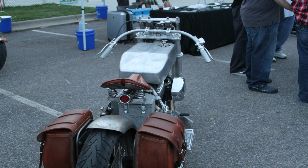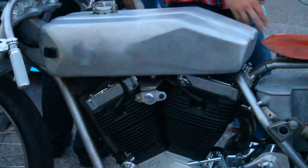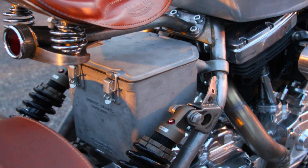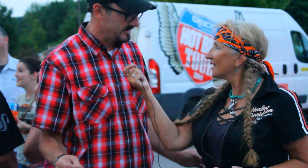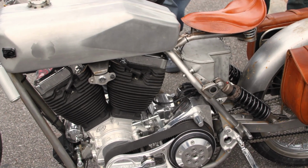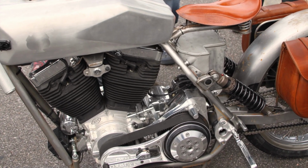We then drew it up in SolidWorks, and it's a cast part. It's a rapid prototype cast aluminum part, as well as the battery box is. We sanded this down to give it a cool look, but this is as cast. And so we've got the battery in there and all the fuel injection. The motor is the original WFB motor that Laura set the land speed record with in '06 and '07 until she needed a little faster one. So we had the motor sitting around. It's 170 horse.